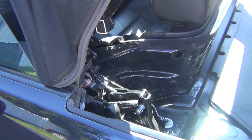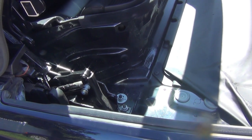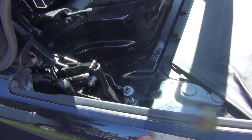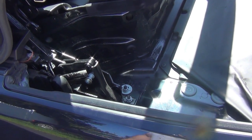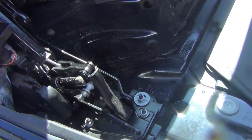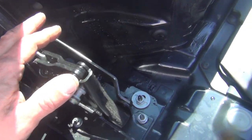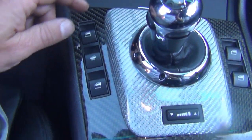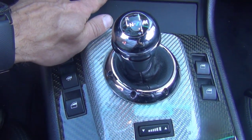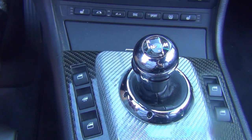When you're in this position, you'll have a limited amount of time before the system will depressurize anyway — about five to ten minutes. So every five minutes of working, you should hop back in the car, hold the brake, and just move the top slightly. It will repressurize and give you the time that you need.